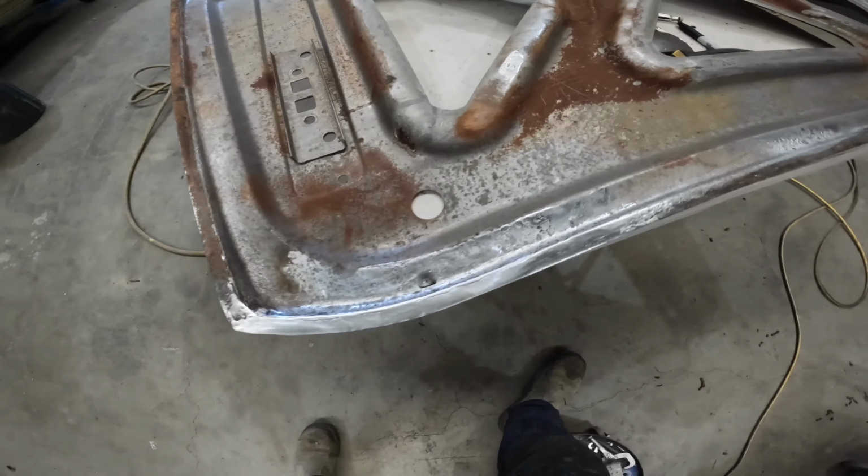And that's the finished boot skin there. No file marks on there. That's just hammered over by hand and then pressed over with the skinning tool as well. It's got all the proper curves and shapes as they should do. Nice reverse curves on the outer sides. Nicely finished off, nice straight piece of steel, no rust, the reverse curve on the top back edge there.